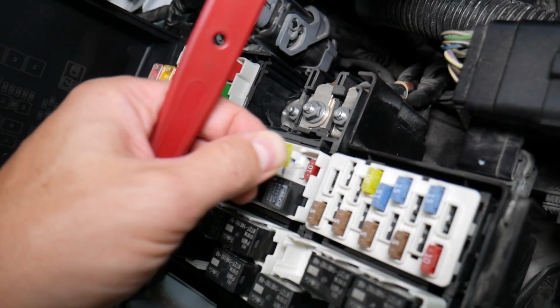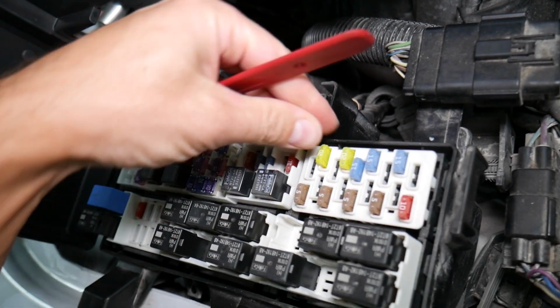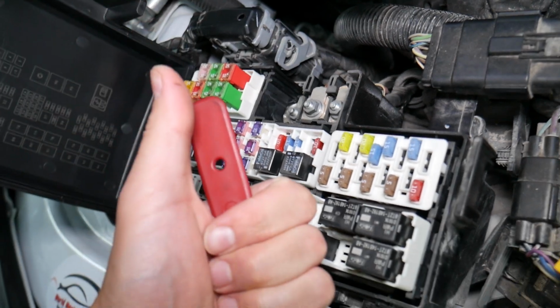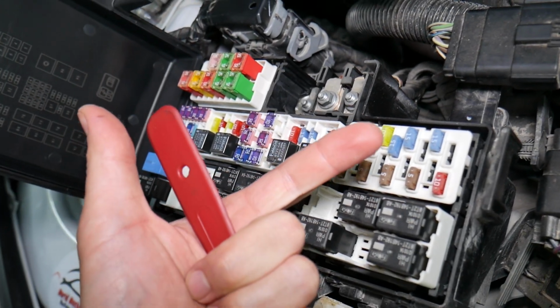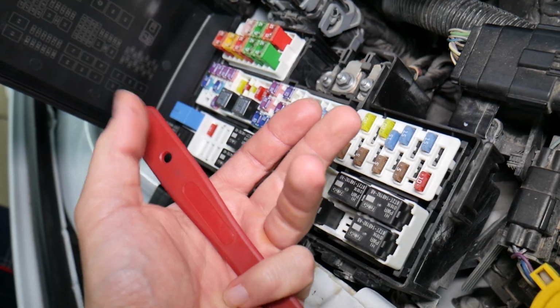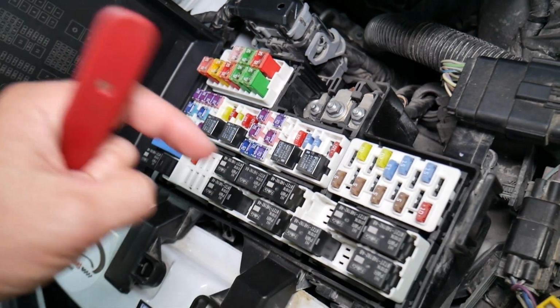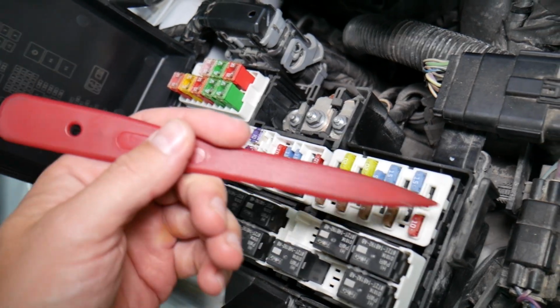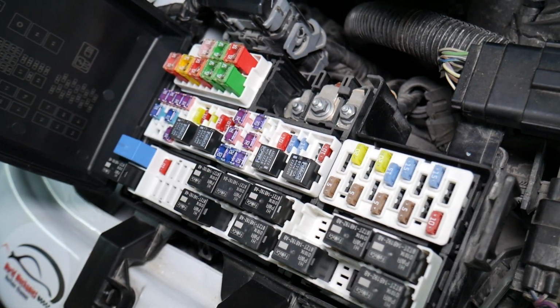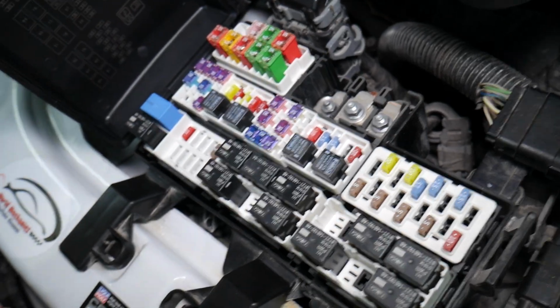What can easily happen at that point is you put the bad fuse back in and you start replacing parts and tools that you don't need to, so you lose your time and your money to fix a problem that doesn't exist, when all we had to do is test the fuse and replace it. We'll put a link to a special video that will teach you how to test fuses and how to check relays very easily as well. So check it out, it will be in the description of the video below.